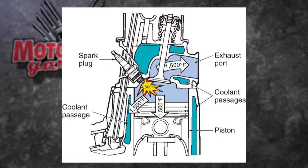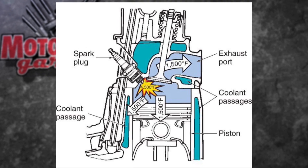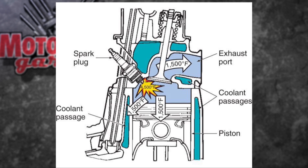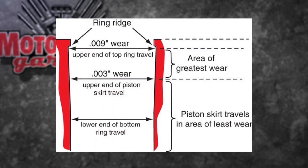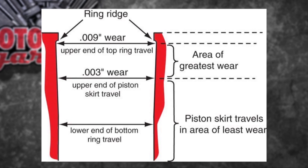Now, along with that four-stroke cycle, you have some wear issues going on. You see the first graphic right there? We're talking about 4,500 degrees inside of that cylinder, 1,500 going to the outside coolant jackets. And even more important, the ring wear — you can see that on the cylinder going up and down from the lower to the top. You've got a lot of ring wear and you could create a ridge.